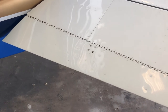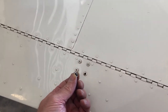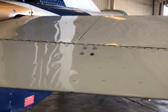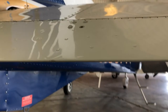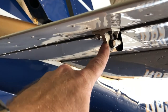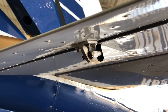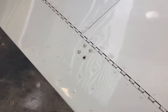We were using an orbital polisher on the airplane and it got under this screw head and just ripped it off. It must have been corroded. I looked on the forum and there are two or three posts talking about how these are prone to corrosion, and a lot of people mentioned that they pulled their screws out and they were completely rotten. These are the screws that hold the trim tab horn — this piece here. There are some pretty graphic pictures on the Twin Cessna Flyer Owners Association website. So I'm going to get my A&P to pull the plane in and replace these, because they definitely are rotten.